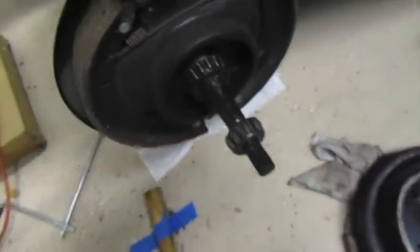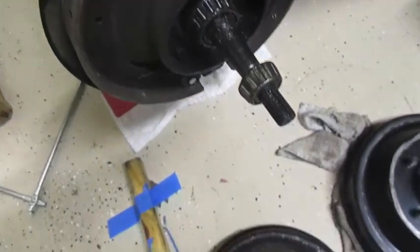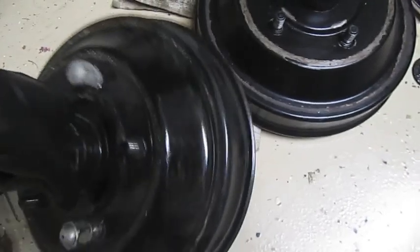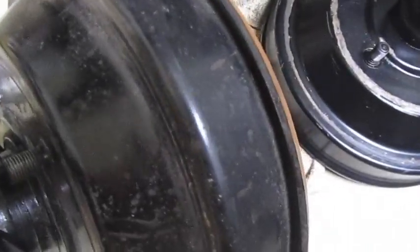When these are mounted on your car with your tire and wheel it's hard to tell just by glancing, but the way to identify them is to tip them on their side. A steel drum has a distinct lip on the edge — you may have to pull your wheel off to see it. Do you see that lip? It really stands out — it's like a thin curled-back edge.